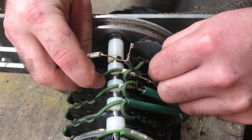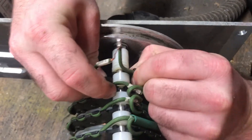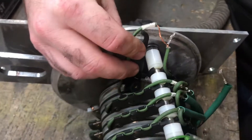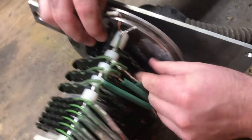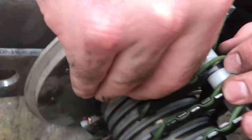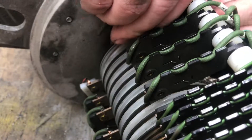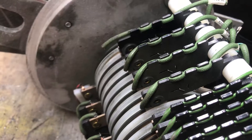I'm going to put the one brush under there and push it onto the shaft, making sure my spacers are at the right spot and that the brush is going into the right ring on there — which it is. Same thing on the other side. I'm going to try not to overextend the spring because it could be damaged if you pull it too far. Push that on — it's in the right track.